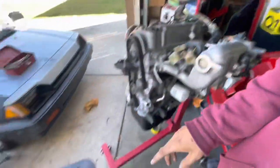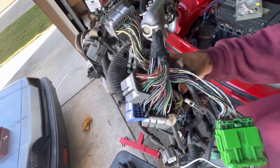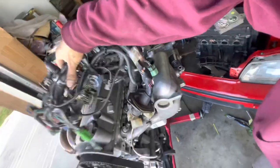EFs have so many different engine harnesses. There are three different '88 harnesses, mismatched '89 harnesses, and three more for '90-'91. I've had friends try to build EFs without the original harness and they run into so many wiring nightmares — shock tower connectors don't match, Si vs HF vs DX mismatches. Forget figuring out which EF harness you need. Instead, grab a 96 to 98 EK harness as complete as you can get — the connectors go all the way to the ECU and it includes everything to run your engine.